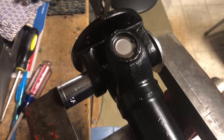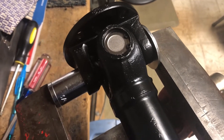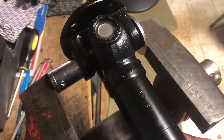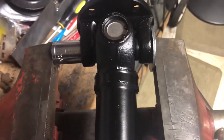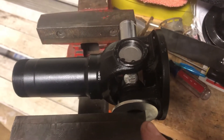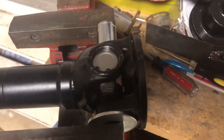Not too sure if you can see this, but this is my press method for reinstalling the universal joint. I've got it in one piece right here and now I'm getting the final section in. Just tightening it up — I put a washer on this side to protect the paint. Already got the clips in here and I've got the other half to go.